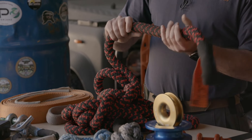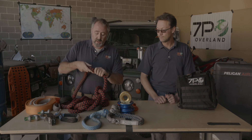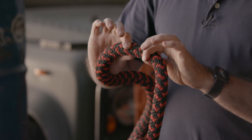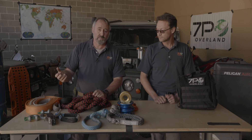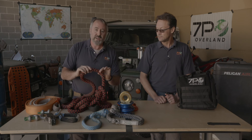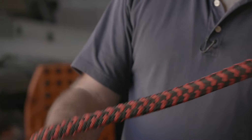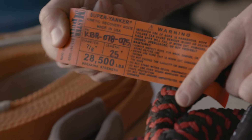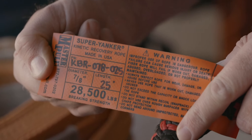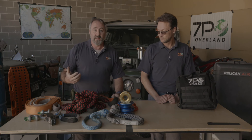We like the rope — it will stretch more than a strap, about 30%. There are definitely a few good ones on the market. What's important about these ropes is that they're quite thick. We like to match them to the weight of the vehicle. A standard 4x4 might be 4,000 to 6,000 pounds, very different from a heavy 6x6 truck. This rope is rated to about 28,000 pounds, and as we'll discuss, we always like to see properly rated equipment that's fit for purpose from a good manufacturer with an auditable supply chain.